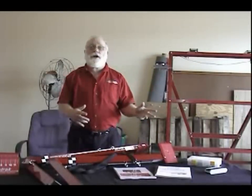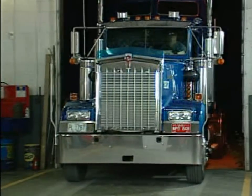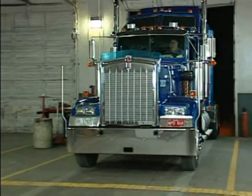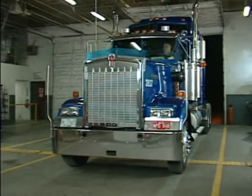The next step is to actually put it on the truck. The first step is to drive the vehicle in straight and roll it to a stop so that you have the as-driven position on all the tires. This is important in order to make sure that your measurements match the tire wear conditions in the vehicle.